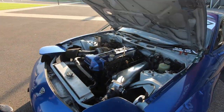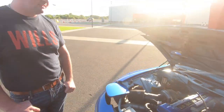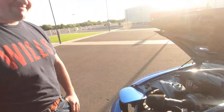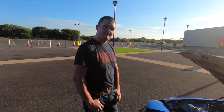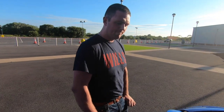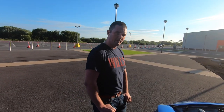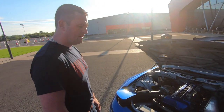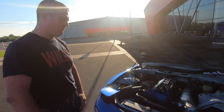What's the suspension on the front — did you go with a conventional lock setup or something you made yourself? Because it's been a budget build, it was just ordinary BC coilovers on standard hubs, and then the grinder and the welder — so we cut the hubs. A lot of people say the RX-7 has pretty good lock as it is. They swap the RX-7 rack into other Mazdas — even the RX-8s always get the RX-7 rack put in. Do you find it's okay for lock? It's been really good so far. I had to space down the track rod ends to stop bump steer, but apart from that it's been very good — I've been very happy with it.